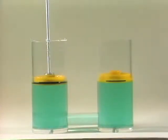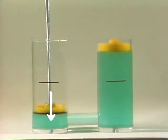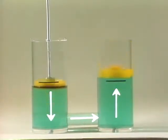Another thing about liquid is that it occupies the entire volume of the container, filling every space no matter what its shape. This mock-up has a weight in each cylinder — we'll call these pistons, like those you'd find in a hydraulic brake system. Let's watch what happens if we push down on one of the pistons, putting extra force on the liquid. The liquid is non-compressible, so its volume remains the same. The effect is to transfer the force to the second cylinder, where it acts on all surfaces, but only the piston is free to move, and so it rises. The area of each piston is the same, so the right-hand piston rises by as much as the left-hand piston is pushed down, because the pressure is the same on the face of both pistons.